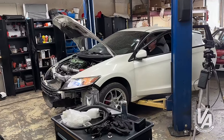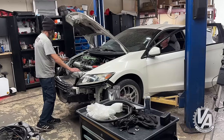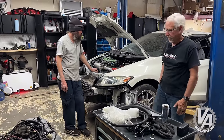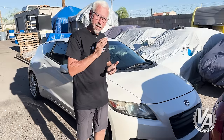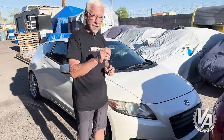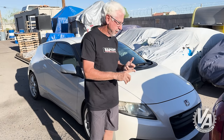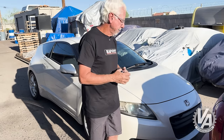It started! That's obnoxious but it started — I'm feeling pretty good about that. I think our exhaust tubing arrives tomorrow so we will quiet this sucker down a little bit. The car for the most part is wrapped up. We actually recycled a custom exhaust from our Series E and made a few modifications to it. So this car has a header plus catalytic converter plus a two-and-a-half inch custom exhaust on it. The only thing left to do is the AC, but I want to take it for a test drive first to make sure everything's working mechanically before I fill the AC unit.